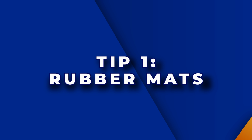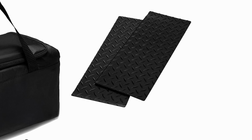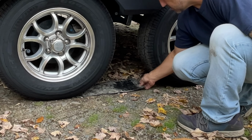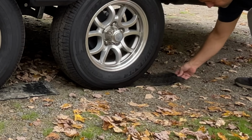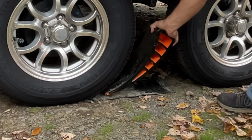So while X-Chocks have nothing to do with the actual leveling process, I always install them at the tail end of my leveling process. So I'd like to share a few tips with you guys. If you decide to go with curved leveling ramps, go with a company that offers rubber anti-slip mats with the levelers. You're applying excessive weight on a curved surface, and the ramps can slide out as you're driving on them if you're on slippery or loose ground.